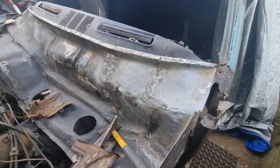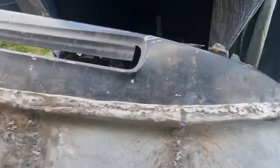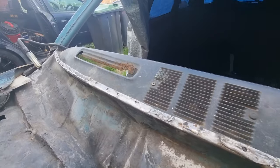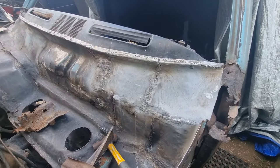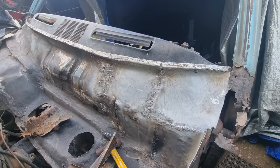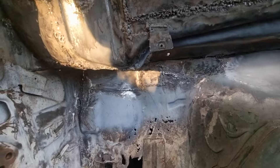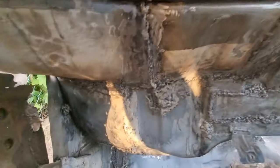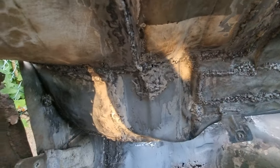That's nearly done — well chuffed. I've been doing small work on the lid. I've just got to finish sanding all of this down and prime it. Just doing inside here now, and everywhere you look you can see seam welds. I am now just going to put some seam seal on it and put a bit of rust treatment on it to protect it, just in case.